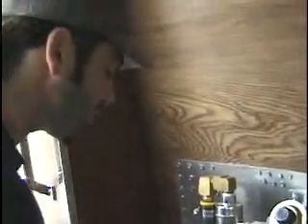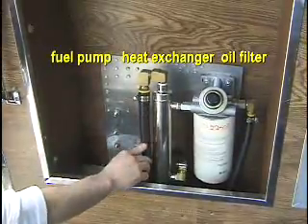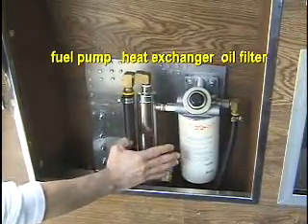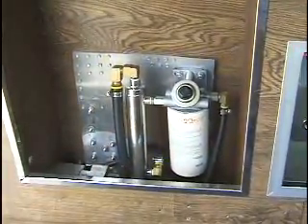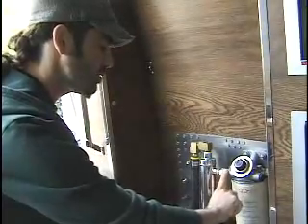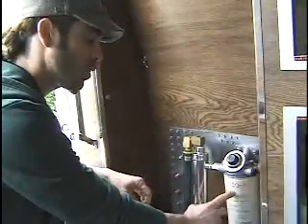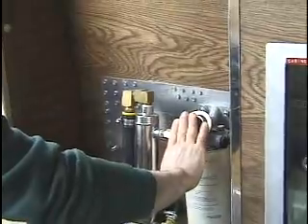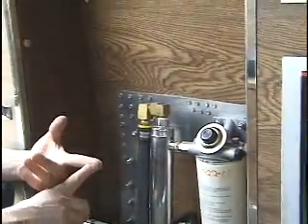From the heated vegetable oil tank, our fuel is lifted through our performance fuel pump, which separates any air, then runs the vegetable oil fuel through the first heat exchanger. As it heats up, it is pushed into our 10-micron filter, which removes any tiny particles, water droplets, anything that could damage our engine. When it's a completely viable fuel, we send it up into the engine, where it enters the second heat exchanger before finally entering the injectors.